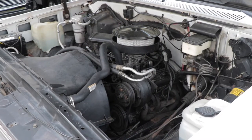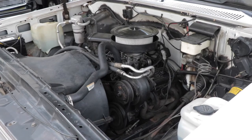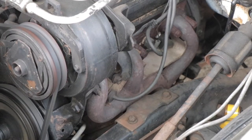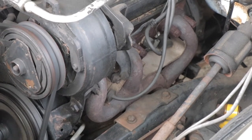To test your motor mounts, with your emergency brake set, start your vehicle, put the car in gear, and slowly bring the RPMs up watching for the motor to rise or fall. In this case, the driver's side motor mount is completely shot.